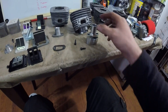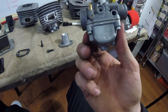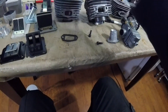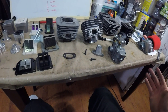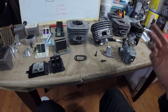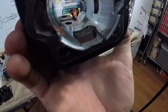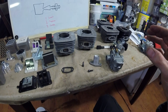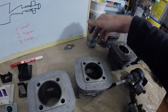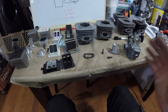It's really simple but slightly complicated because of carb size and all the other part sizes. Really what you want to do is match everything up so your carb size is close to your manifold size, your manifold is close to your reed valve size, your reed valve is close to your intake port — if you can get all those really close or the same, you're going to have really good results. My very first quick engine was literally this manifold with this exact carb — just cylinder, manifold, rubber hose, carburetor — and it was snappy and pulled 47 miles an hour on a 41 tooth at around 11,000 RPM.